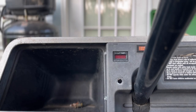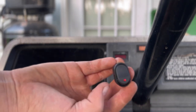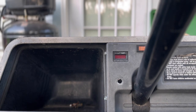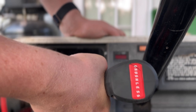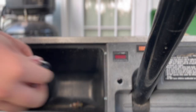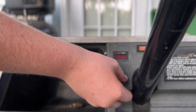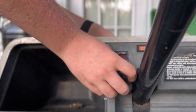The last step before we hook everything up is to drill a small hole in the dash for the hazard light switch. There's already a small hole there from the last switch, but it's not big enough, so I'm going to enlarge it — it needs to be 15/32 inches, I believe. The easiest way to do that is with a step bit. Then we'll screw the plastic nut off from the back side and wire everything up.